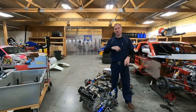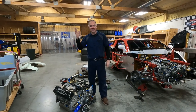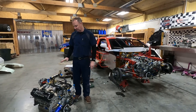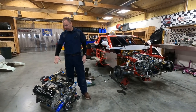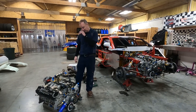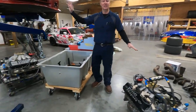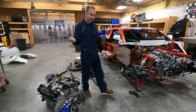Tip of the day: when your oil pressure light goes to zero and the warning says no oil pressure, push in the clutch and shut the ignition off. That's what you do — whether you're getting hot, whether you have no oil pressure, whatever. Unfortunately, the driver made the mistake of going ahead and driving it in with zero oil pressure for about 45 seconds to a minute. The engine is not blown up, but after running an engine with no oil pressure for that amount of time, the engine builder — PME, Pro Motor Engines — said they can't run this engine anymore. They had a very short time at Sebring. So this engine is out. We're going to transfer some of the pieces over to engine number three so he actually has a spare. He did not have a spare engine with him, so they loaded up and came home.